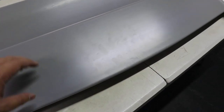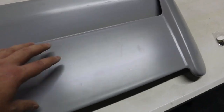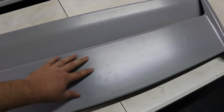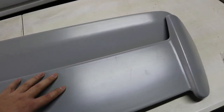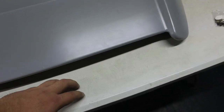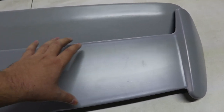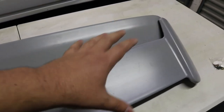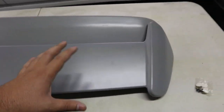Apart from the few scratches and the edges, you could get away with just scuffing and spraying it. However, they call this 'primer' but it's not actually primer — it's just plastic the color of primer. Because this is raw plastic, you can't just spray over it. You will have to use an adhesion promoter or plastic primer, otherwise if you just spray rattle can paint over this you have about two to six months before it starts peeling — and it will peel, guaranteed.